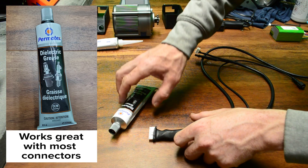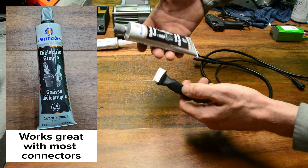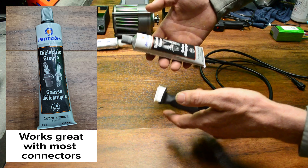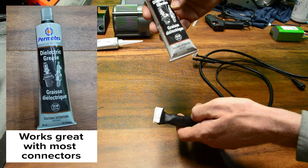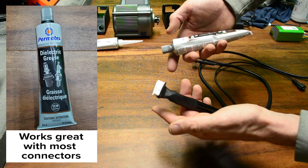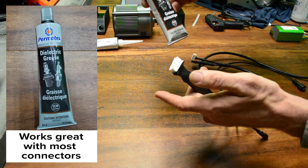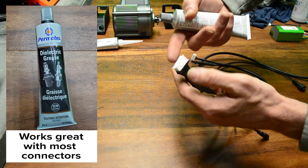The first layer for me is dielectric grease, and it's a really useful layer of protection that often gets overlooked. In many ways this is possibly the most important thing you can do with this connector. You can get this in any automotive place, and a smear of it on the end of the connector before you plug it in is all you need. It's a silicone-based grease, also called tune-up grease, and it repels moisture and protects the electrical components against water ingress.